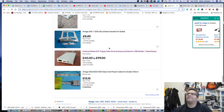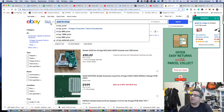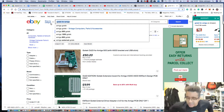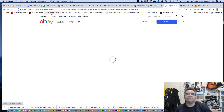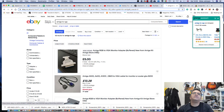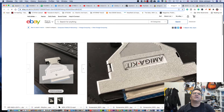For the screen, I'd say Amiga to VGA is the way to go. I think I've got mine connected through the VGA port — I don't want to move it and knock the monitor over. You can get an Amiga RGB to VGA adapter, so you'd use the RGB port on the Amiga and convert it to VGA for a modern monitor. AmigaKit do them — you can see it here, the Amiga RGB to VGA adapter.